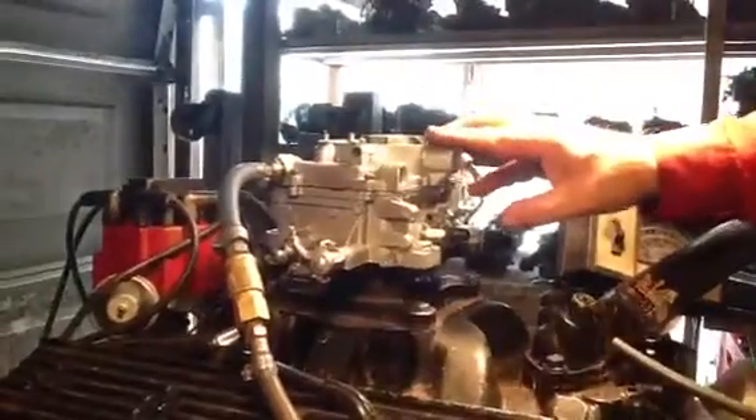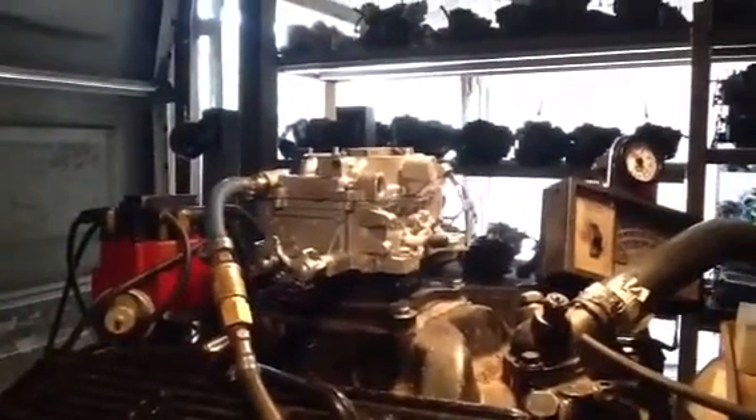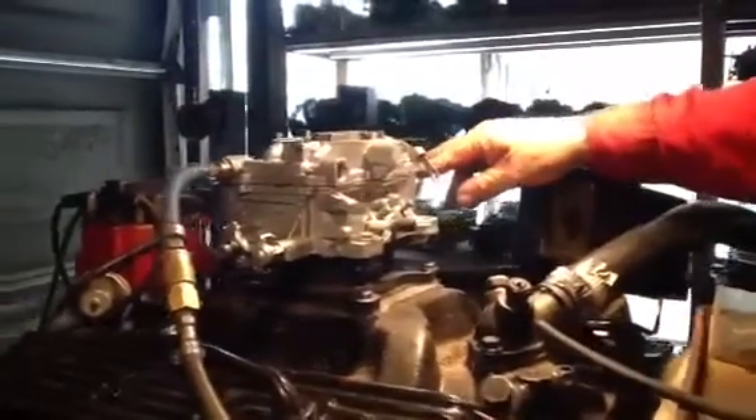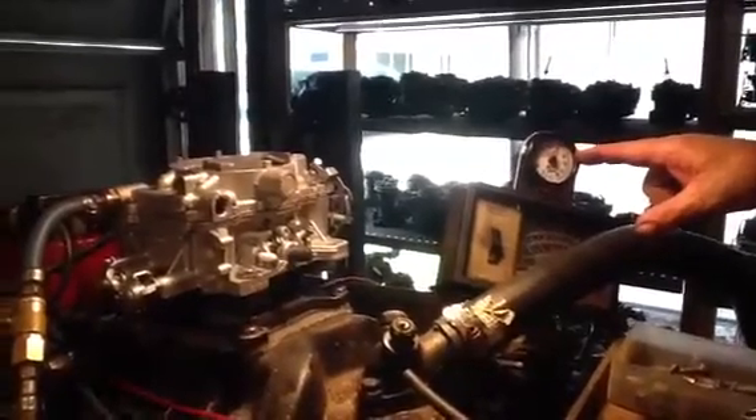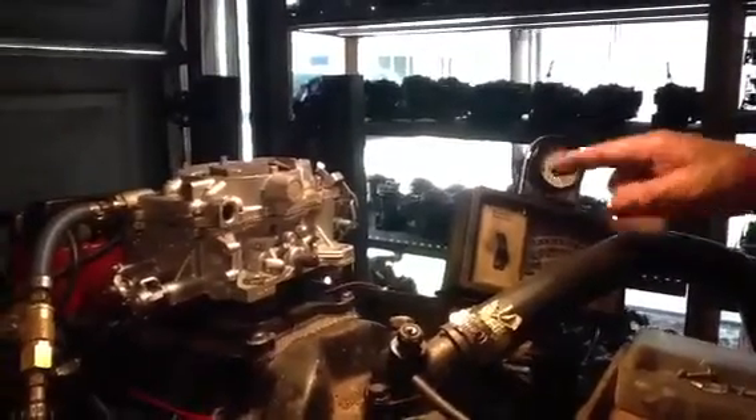Do not call us, do not email us to ask us why it's flooding all over the place. Now this carburetor will run by itself — you can block one off, put a plate in there just to scare people with, or you can run it simultaneously, or you can run it with progressive linkage. This one here has no choke. This is computing the amount of air-fuel ratio going out the exhaust system through that carburetor — it's calculating about 13 parts of air to one part of gas.